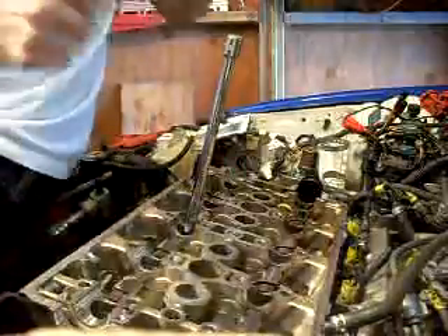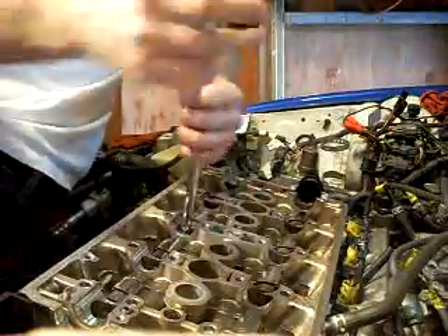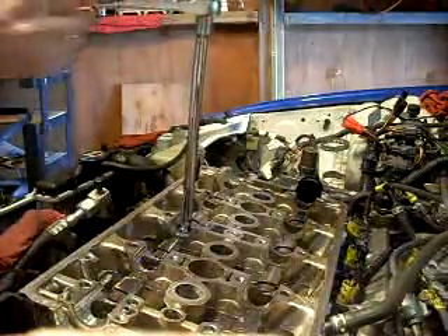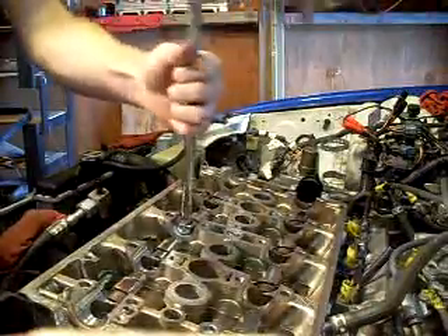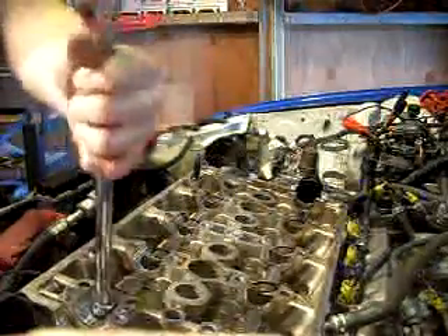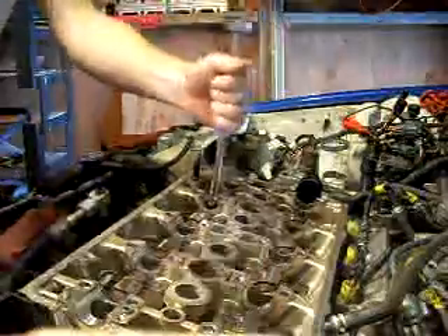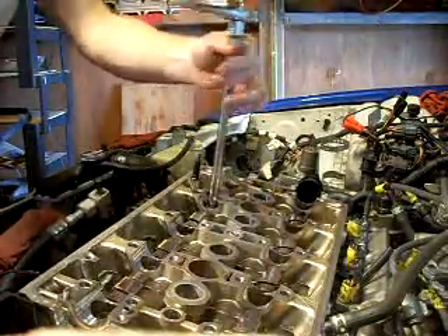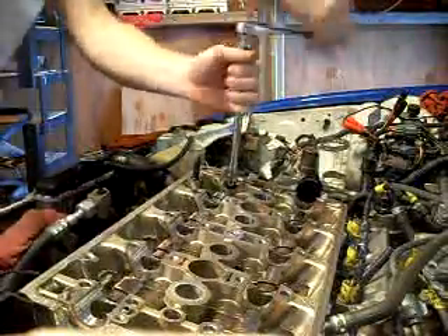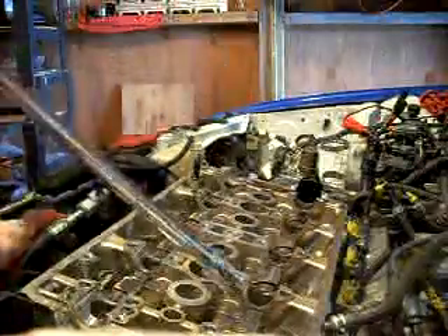This is what the wrench is for. The reason I'm changing the head gasket is because I have pressure in my radiator. I did a leak-down test — I put 100 pounds into the cylinder and it created pressure in my cooling system. I would pop off the radiator cap and there would be pressure going 'puff.' So I suppose it could be the head gasket.